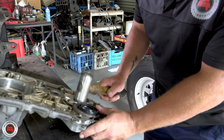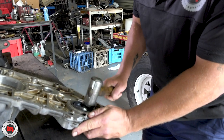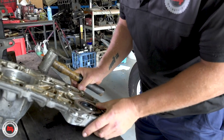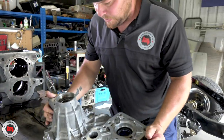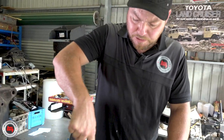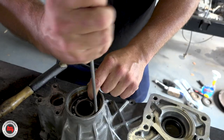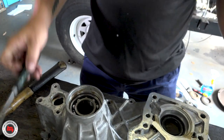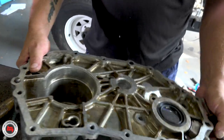Being careful with the nylon hammer knocking the new seal in. Certainly not something you do with a screwdriver. Now I'm going to remove this bearing out of here - it's quite noisy actually. Get the little C-clip out before we knock it out from the other side and replace it with a new bearing.